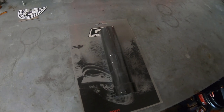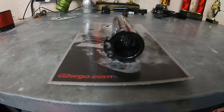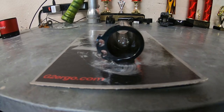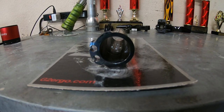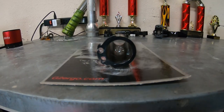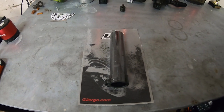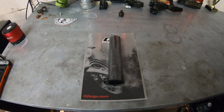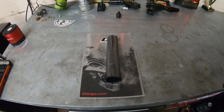This is the tube, and what makes it unique from the factory sleeve is it actually has material added to the sleeve at the end. That added material will stretch the cable more, which in turn lessens the twist on the actual grip. So let's get that old grip off.